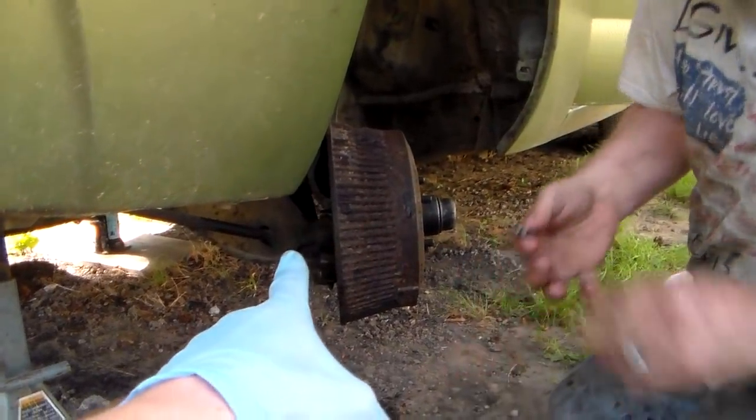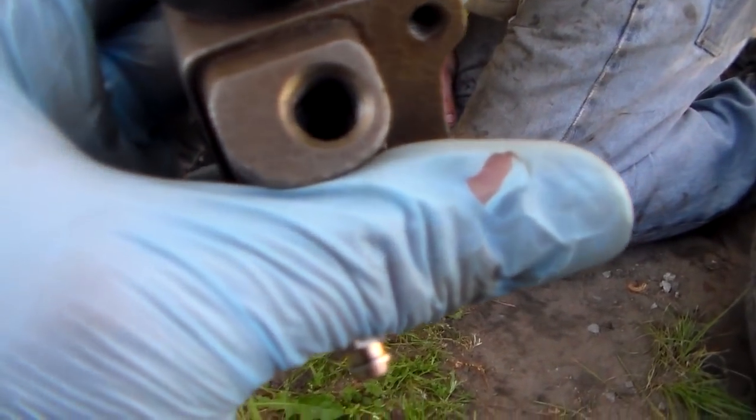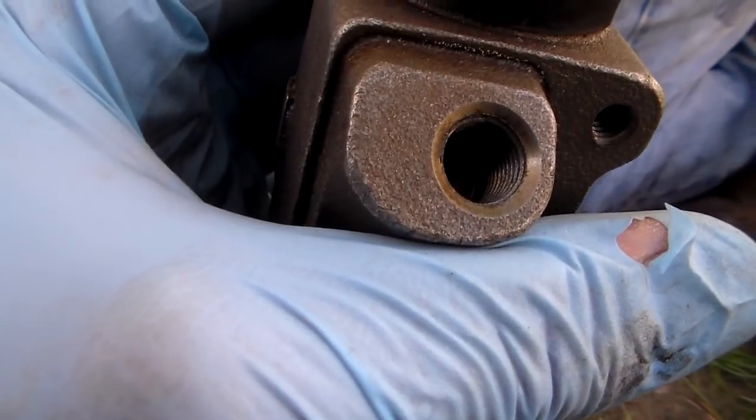And Phil says that he can't use this wheel cylinder because that piece of line that they replaced last summer, whoever they were, won't fit in this one. It won't go all the way down because the, I guess you call it the flare or whatever. It doesn't thread in far enough. That's right. The line. So we discussed this on the phone, guys.